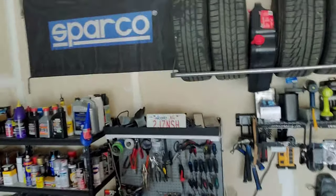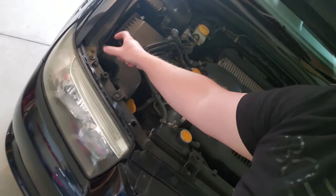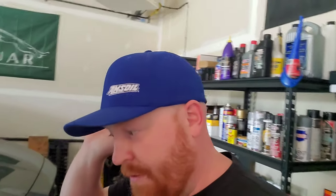It doesn't seem like it's too difficult. I'm going to take out this piece which leads to a chamber that is like a foot long, 14 inches or something, that feeds back into the intake so you don't hear it. Obviously it's a Forester, it's not a sports car or anything, so they probably put it there for good reason, but it is looking very restrictive to me. We're going to take this bad boy out and see if the STI has it too, because the STI has something similar but I think it's just a U-pipe because it's an STI, but we'll find out.